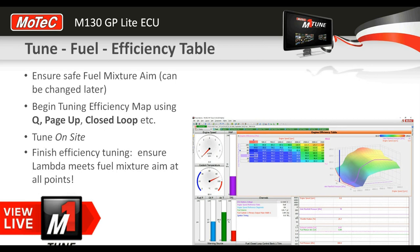So the process of tuning is kind of, you're going around in a loop. You get the fueling in the ballpark of okay. If you do use closed loop, then you really don't need to get too carried away with the efficiency map, as long as it's somewhat close or in the ballpark. Closed loop will keep it tidy for you while you go and concentrate on things like the ignition, as I said, fuel timing and boost control if it's a turbo.